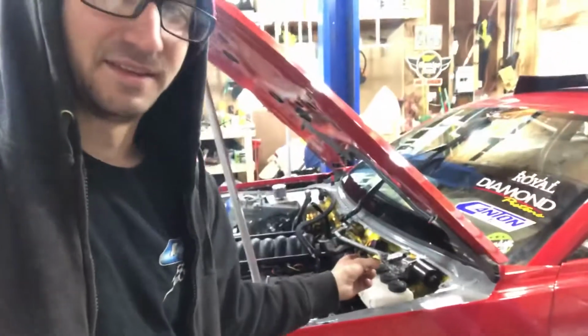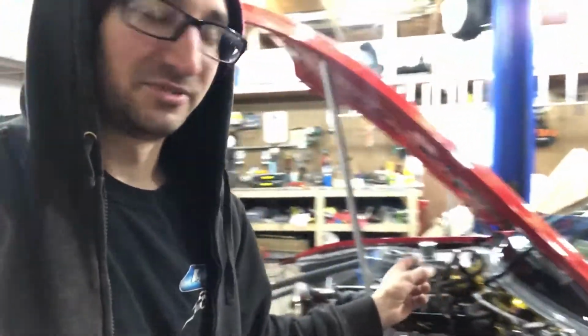And that's when I realized that motor grounds itself to the body of the motor. And yeah, it was self-grounding to the chassis, so I couldn't control the speed with the power ground inputs to the actual motor because it had ground to the chassis also. So that didn't work. And the more I tried to mess with it, I ended up actually breaking the pulse width control module, or the DC motor speed controller. So that didn't work at all.